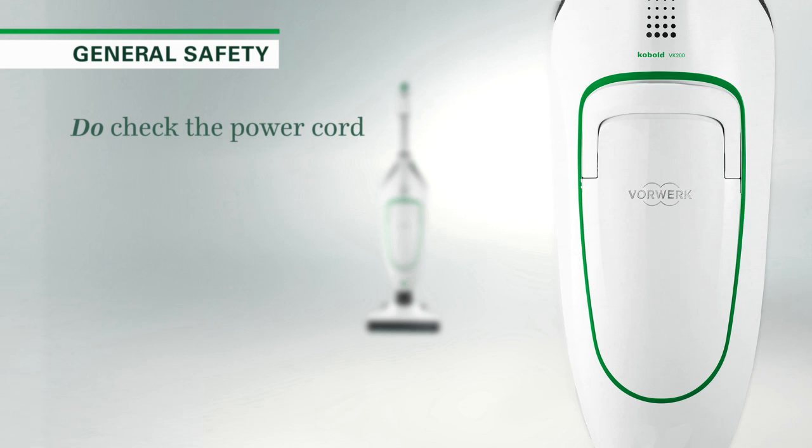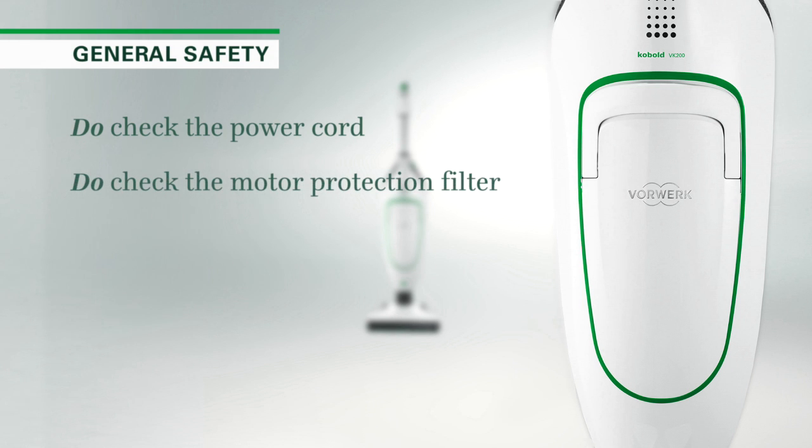Occasionally check that the mains cord slides freely as you move the VK200's main telescopic handle up and down. You should be able to move the handle without holding onto the cord. We also recommend you check the motor protection filter is fitted before you use the device. Always ensure you disconnect the VK200 whenever it's stored or simply left unattended.